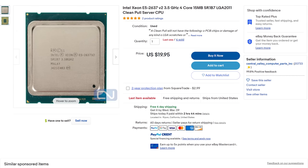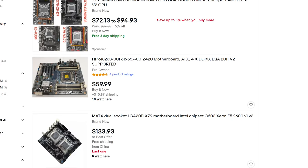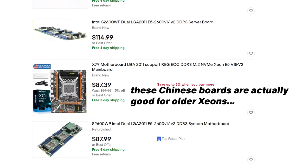Another reason to look at the age of the platform is to determine memory specification, PCI compatibility, IO, and how readily available parts will be. Sure, you can find a really old, cheap Xeon CPU with four cores, but you may have trouble finding a motherboard to go with it. You'll be stuck using older RAM and be without modern creature comforts like USB 3.0, NVMe support, and in some cases limited PCIe slots.